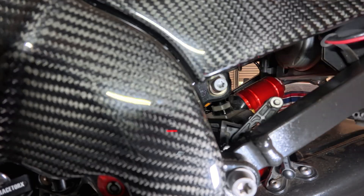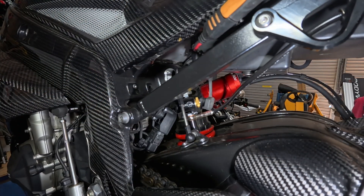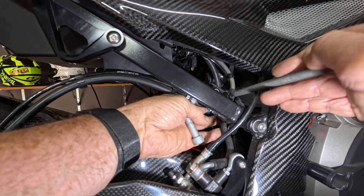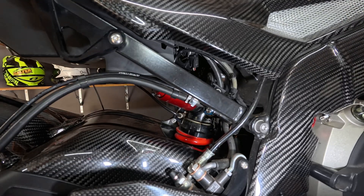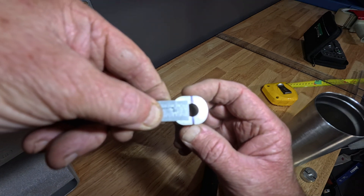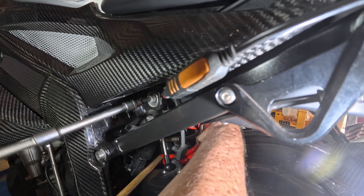Once you drop that sensor, it's simply a matter of undoing the bolt completely and pulling it out with a pair of pointy nose pliers, then removing both spacers. The left-hand side is easy — just pull it out with pliers. But the right-hand side is quite tight and behind a few cables, so I used a piece of threaded rod, screwed it in, and wiggled it until it came out. I used that rod to replace the spacer back into its new rotated position — with the hole closer to the top, which is effectively the same as shortening the shock, because it lowers the back end of the motorcycle. Once the spacers are back in, it's just a matter of lining up the holes, wiggling the bolt in, and tightening it to a torque of 56 Newton metres. Then reattach the sensor and take the weight on the rear wheel with a paddock stand, removing any stands from under the chassis.